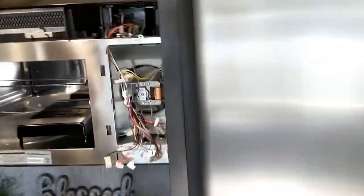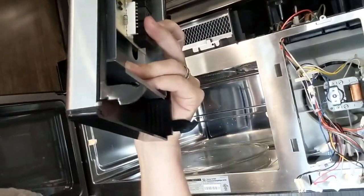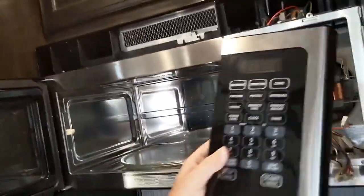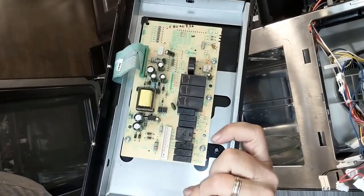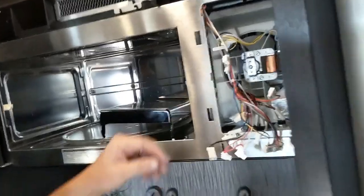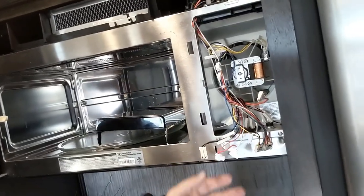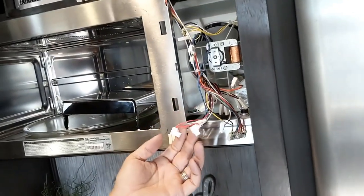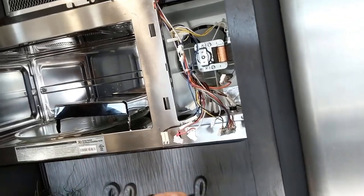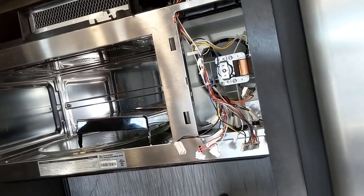You actually have to go to a small appliance store to get that replaced. If it clicks, it's supposed to be good. So I already took all this apart. We've got all the wiring here - this is the front piece that goes on, with just two little tabs on the bottom and a screw up on top. The wires in here weren't long enough to just leave it dangling, so I took pictures and disconnected everything. The only tricky one is this one here where there's a red jumper - red goes to red, white one goes on bottom, one on top, in between the two black wires.